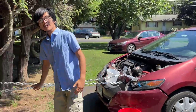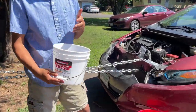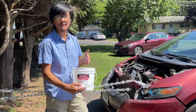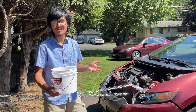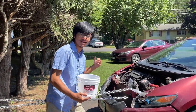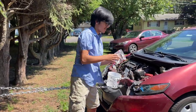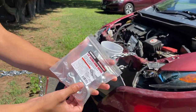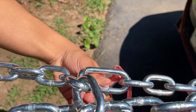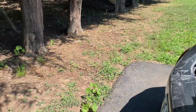Here's the idea. We have a chain we got from Harbor Freight Tools — this is a 5/16th chain that can handle 2,000 pounds. Maybe a 1/4-inch chain would also be good; that can handle about 1,000 pounds. Even though the car is more than 1,000 pounds, all we need is enough force to pull this forward. So 5/16ths is good. If you need to attach it, you can use a grab hook. In our case, we've just looped it around and tied it together using a quick link fastener.